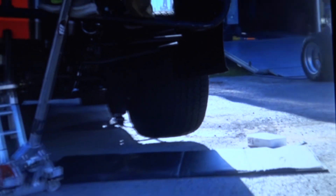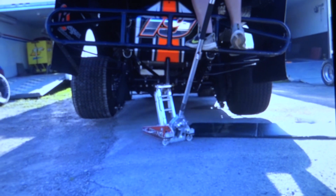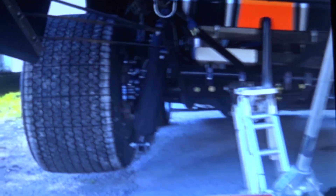And when we take away the stagger, when it slickens off, what does that do for you? With these cars the way they are, you don't take away as much as we used to on bars, but it will really tighten you up when it gets slippery, because you aren't dragging that left rear anymore. You get that left rear closer to the size of the right rear, and it's obviously going to make more traction.